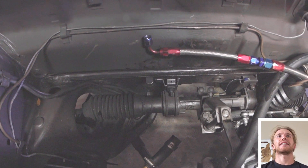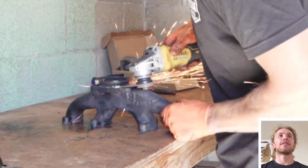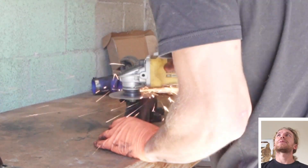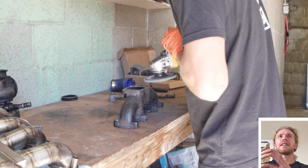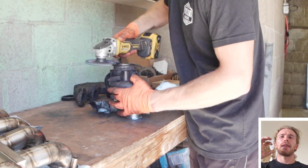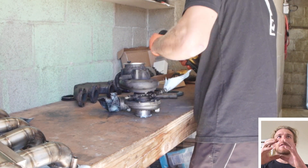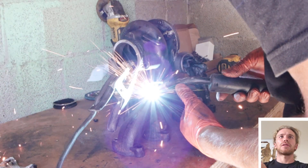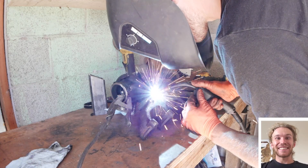You can even see it right in the middle of the screen there under that oil line — there's soot on the back wall. So my fix: what happened was the V-band I was using just stopped sealing well for one reason or another. I think the original clamp part might've broken and come loose, and that allowed enough play for the two flanges to hammer into each other with the vibration, which eventually led to them just not being able to seal.